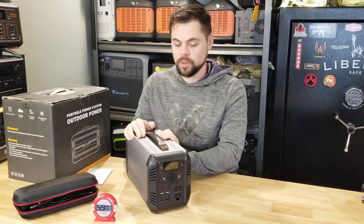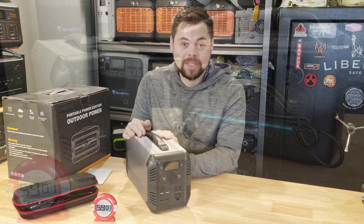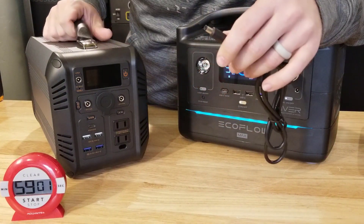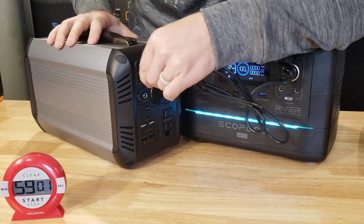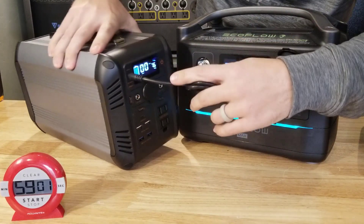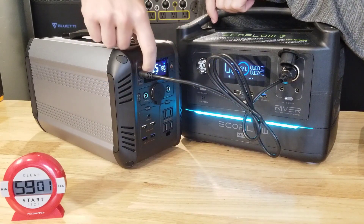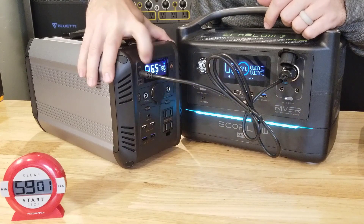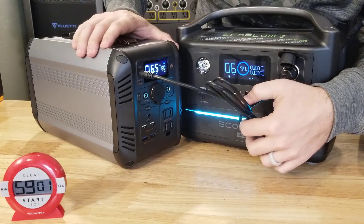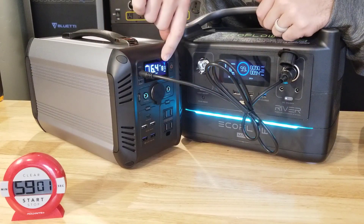The next question: if I plug a power source in while it's warm, what happens? It's usually not recommended, but let's see. I'm taking my EcoFlow River Max, putting the DC charger on, and plugging it in. It immediately goes right up — it says 100% on the battery while charging, then adjusts to 0% and charging. It'll take 6.5 hours to charge. It's outputting 94 watts and actually receiving 81. It's pretty cool that it shows the exact wattage and time to charge.